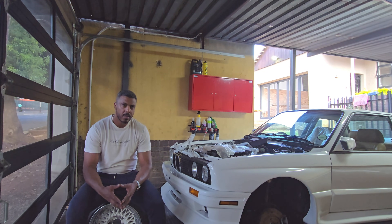One of the considerations that leads people to do a motor swap on the BMW E30 is that this is old-school technology. It has a single overhead cam — one camshaft running across the entire head. There are not so many valves in an M20, only 12 valves — two valves per cylinder. The intake valve is bigger than the exhaust valve, and a single overhead cam with two lobes controls both intake and exhaust. There was no need for a dedicated intake camshaft and exhaust shaft. With a single overhead cam, you cannot precisely adjust and manipulate the intake and exhaust timing, and therefore you cannot get the pure top-end exhilarating performance out of a single overhead camshaft engine.